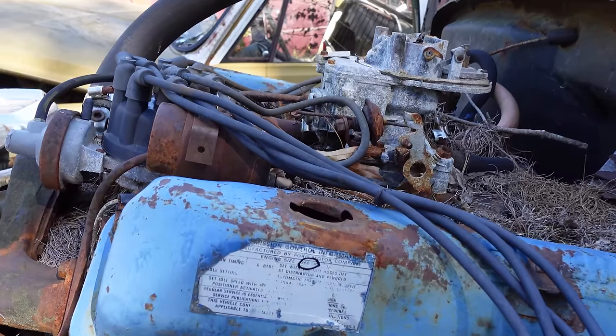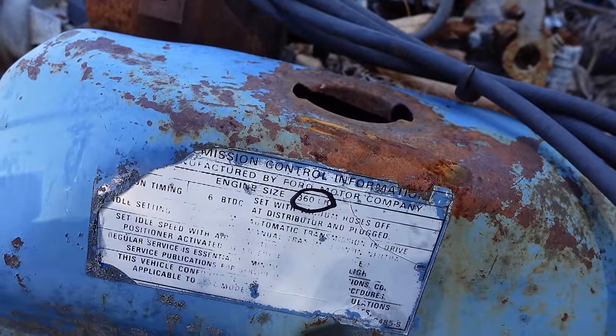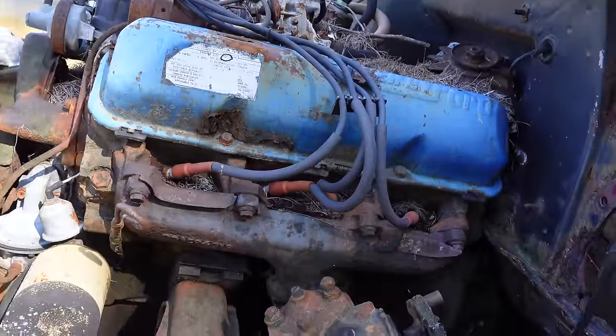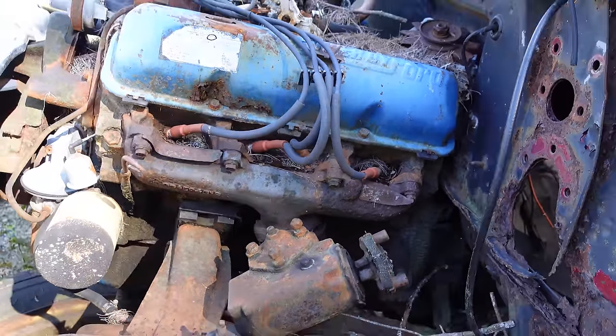So this is the Ford pickup truck version of the 352. It's 30 thousandths bigger than the 352, but again, 360, log manifolds, two-bolt, no cross-bolted mains on this one. So it's possible this is factory installed, but we'll know more about that in a second when we look at the VIN.